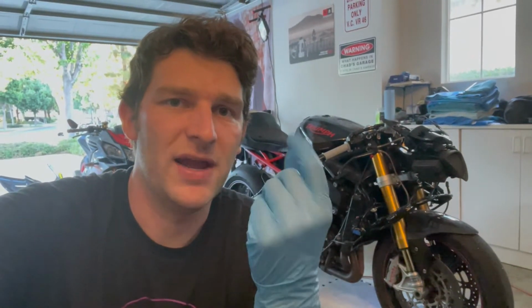And yeah, just kind of go as needed, but parts wear out very quickly as well. Brake pads last maybe 1,000 miles. Rotors need to be scrubbed and possibly replaced if they're not within the spec for how thick they're supposed to be. I haven't gotten there yet with these rotors, but I'm sure I will sooner than later.